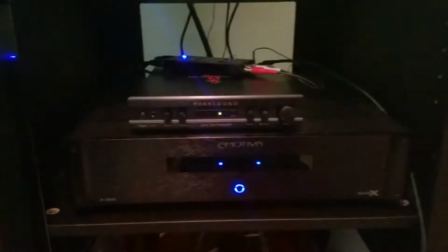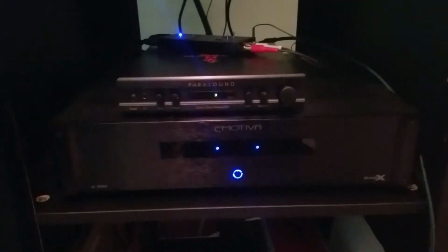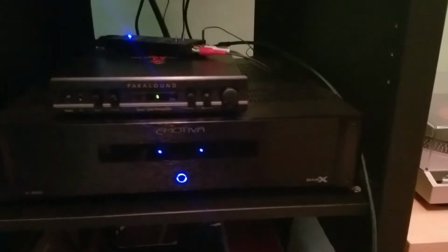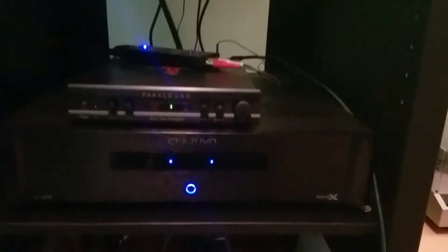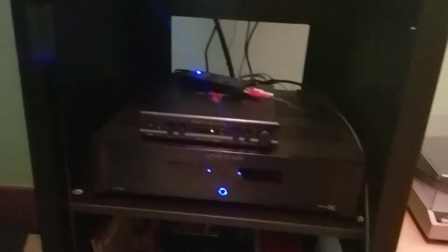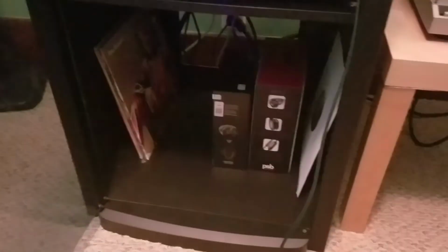However, using a stereo amplifier, any AV receiver that does not have a phono input, and believe you me, guys, the NR1606 from Marantz, and if I'm not mistaken, all of the slimline AV receivers from Marantz do not boast a phono preamplifier in them. Hence, they have no phono input on them. In which case, absolutely, there's an absolute need for a phono preamplifier then.